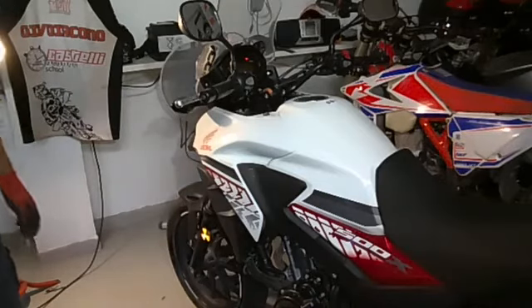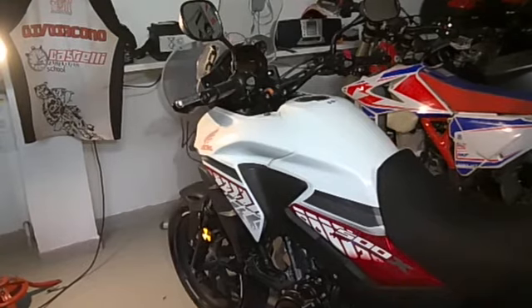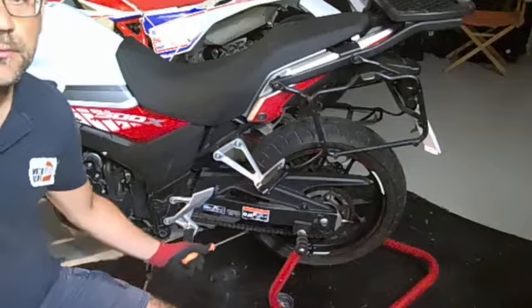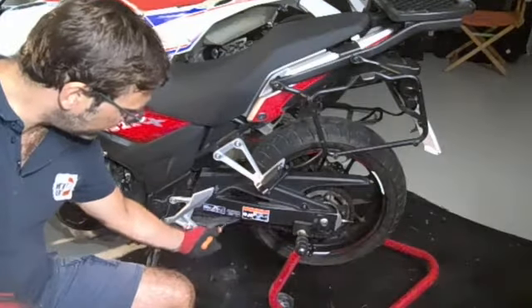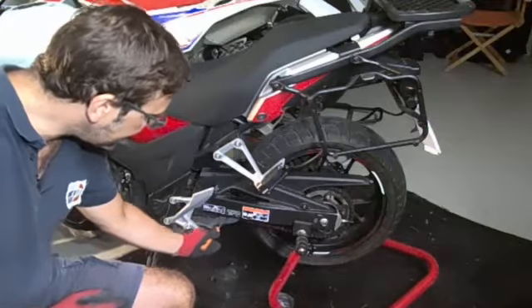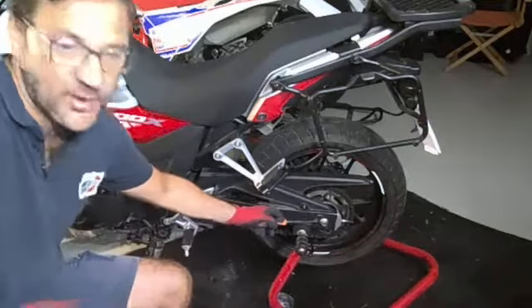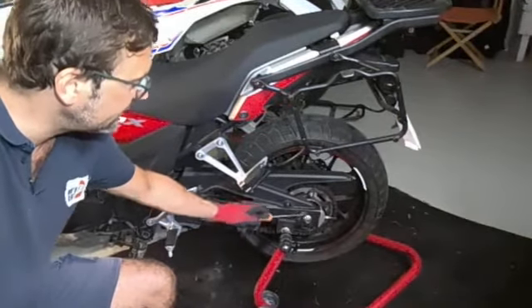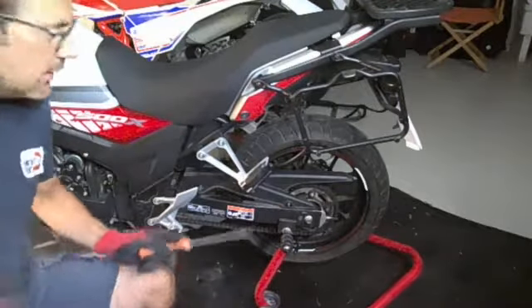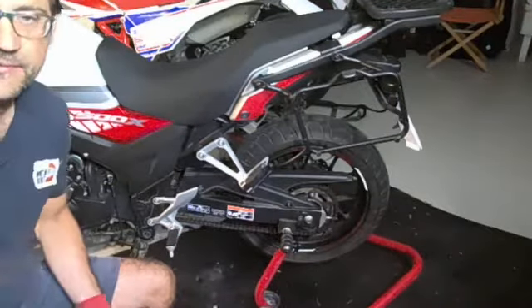The model year is from 2016. The chain total movement is too much — it overcomes two inches and the drive is at the end of the stroke in the rear wheel. So a replacement is needed.